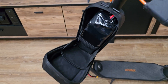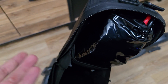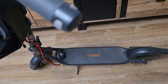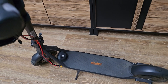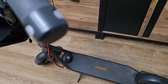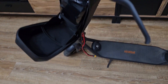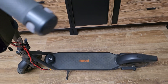To be more specific, I've got a very basic but smart ANT BMS at 40 amps. The scooter won't want output on the stock controller more than maybe 30 to 35 amps — we'll see how the temperatures go. But anyway, the amperage will be split between two batteries, so 40 amps is very okay.